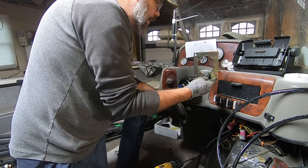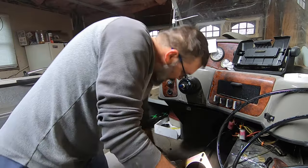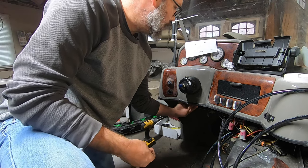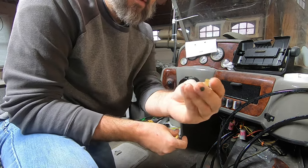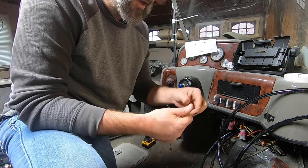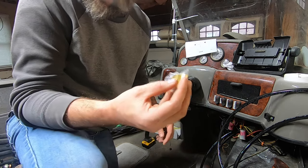Go in the back, put this on. Put all my hardware on. Then we'll install the hoses. Alright, so my boat has a piece of wood in the back as an extra support, probably about 3/4 inch thick, so I did not need these longer nuts. I just put the plate on, the flat washer and the locking nut is all I needed. So just know that you may or may not need these on your install.